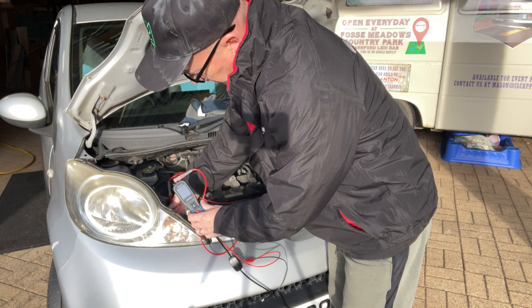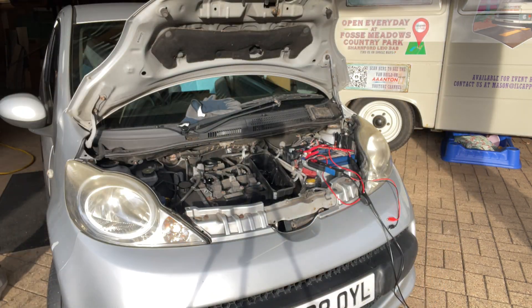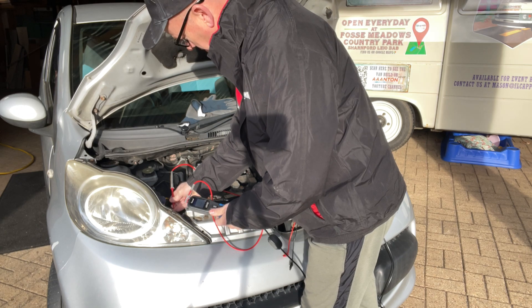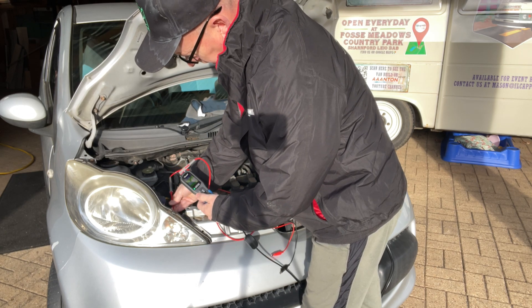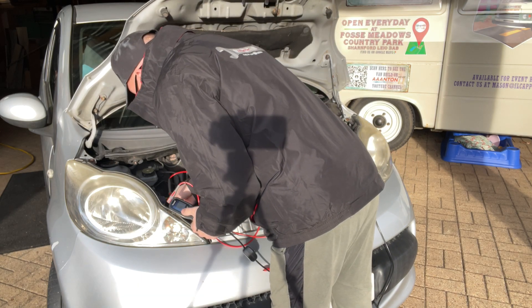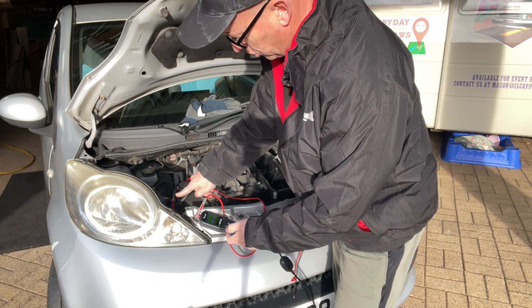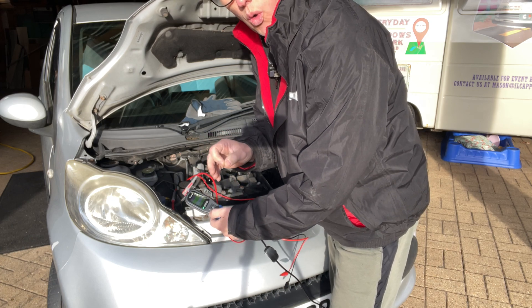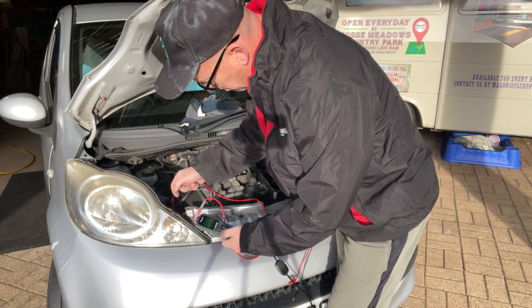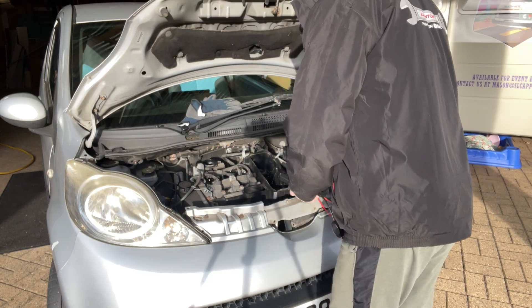You can see as it flashes we're flashing red as we're getting power coming into the unit. I've got my probe there - we can pop that into the top wire and it's gone green, saying we've got a decent earth on it. And if I pop it in the bottom one we've got a decent earth as well, which is saying that the earth is going through the bulb - we've got continuity through the bulb. So without even having power at all, we know just by probing both sides that the earth feed is going through the bulb and it's a good bulb.